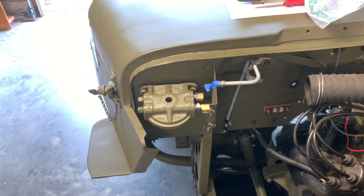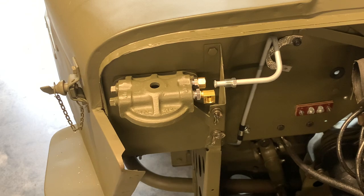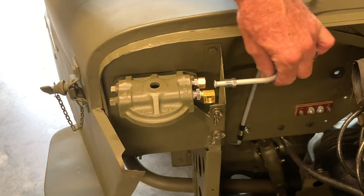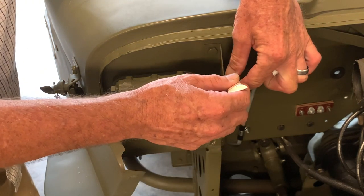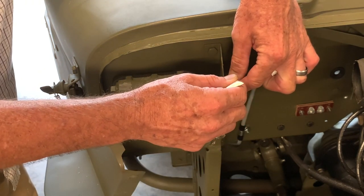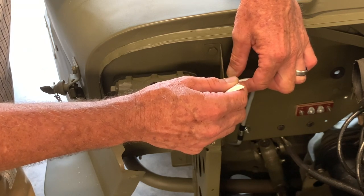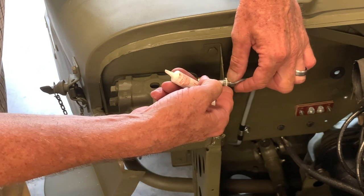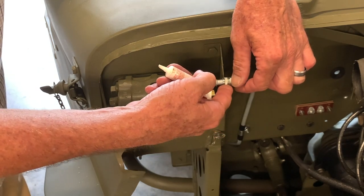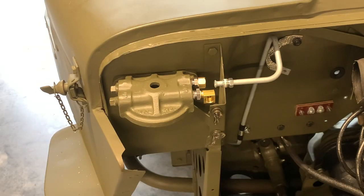From inside the glove box, the order is flat washer first, then lock washer, then the nut — go ahead and tighten them down. Our next step is connecting the fuel line that was installed on the tub — the main fuel line that comes from the gas tank. We're going to apply sealant just like we did with the earlier fittings, just enough to cover the threads. Use your finger to smooth it out — you don't want too much globbing up or getting inside the fuel line.